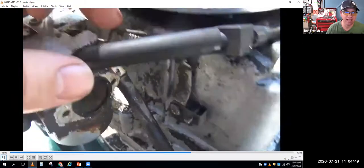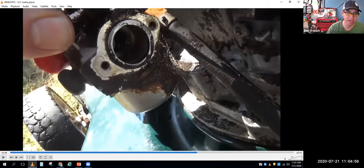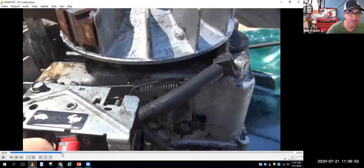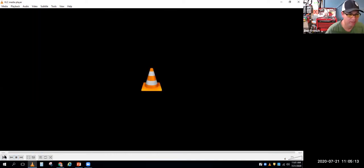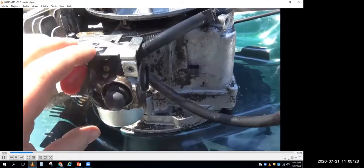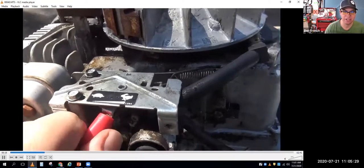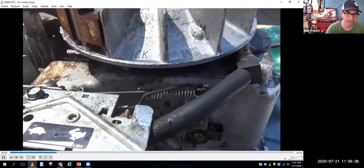And then once I had done that, and if I had figured out that yeah, the problem was a misadjusted governor, what I find is that most people will put too much tension on the spring. Now, if you look at this part of the video clip, I'm moving the little slide valve. Let's try it again. I start moving this little red slide valve between the turtle and the rabbit. When you move it to the rabbit, basically it puts a little bit more tension. And you see how much more tension? Was that a lot of tension? No, just a little bit more tension on the spring to get the engine to rev up.